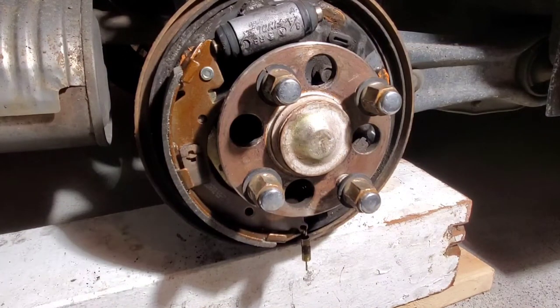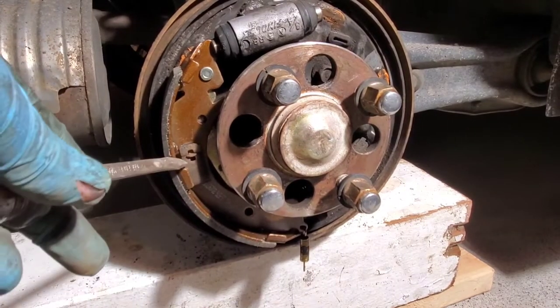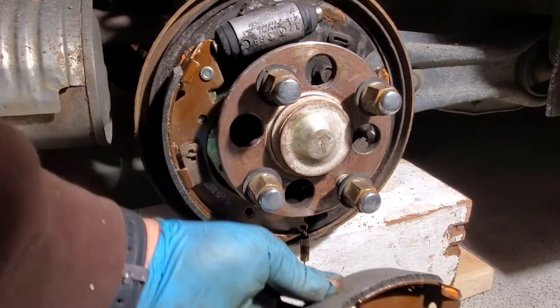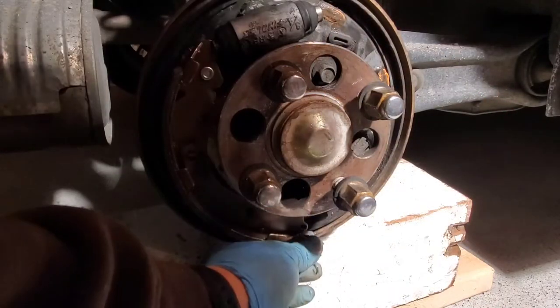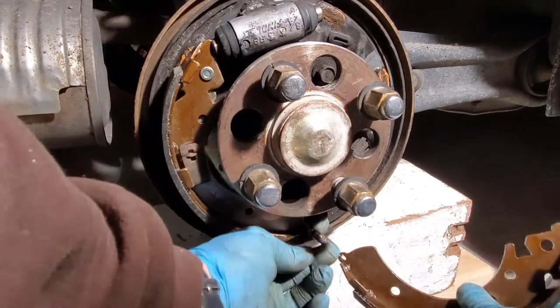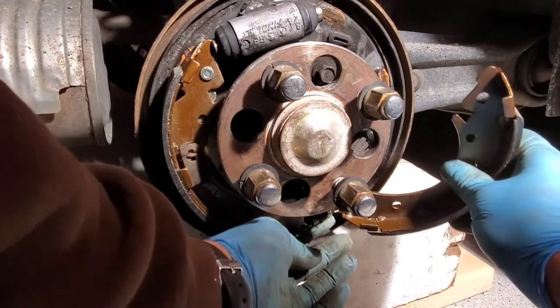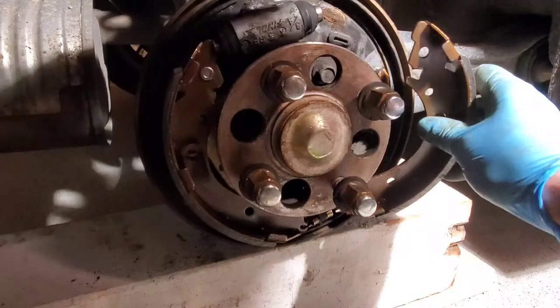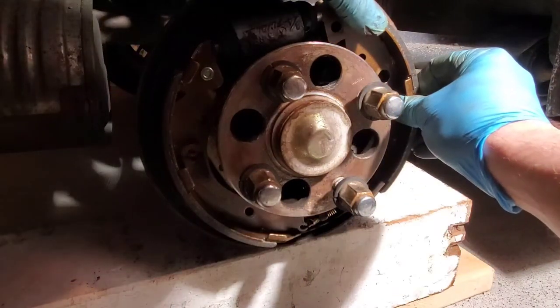Make sure that your clip — you spin it so it fits right inside the grooves. Let's lube up our contact points and put our shoe behind. Underneath here there's a tab, so make sure that the spring goes in behind that tab because that's where it was before.